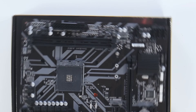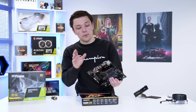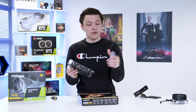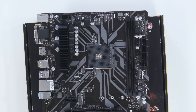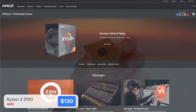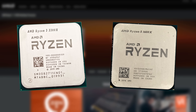The AM4 CPU socket, room for our graphics card, an M.2 drive, and a solid rear I/O with a couple of USB 3 ports — basically all we need. We'll use the included motherboard backplate that comes in the box and pop it through the four holes before installing the CPU and cooler. This is the AMD Ryzen 3 3100, but for this build you've got plenty of options: the 3100, the 3300X, or if you're struggling for stock, a first-gen Ryzen chip like the 1600X. Plenty of options, both new and used.